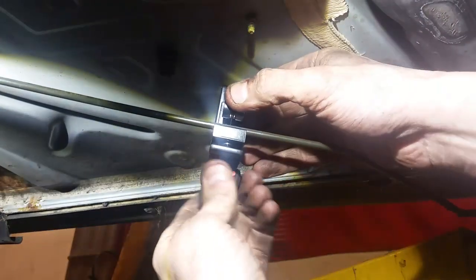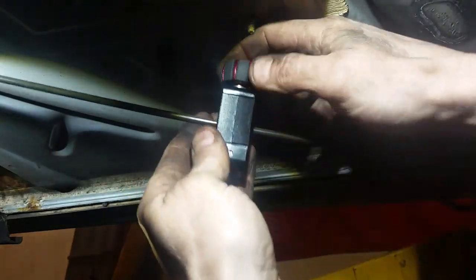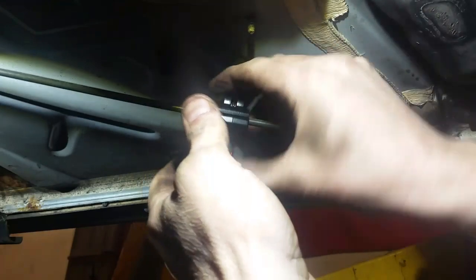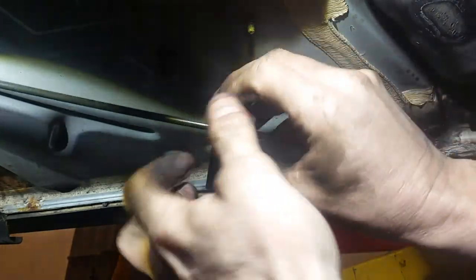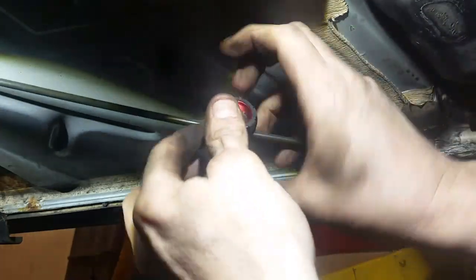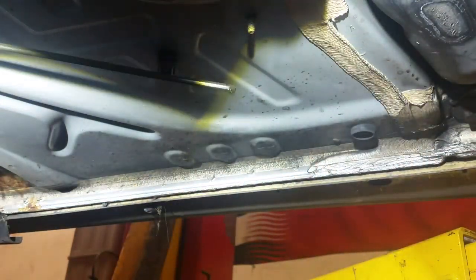So we're going to do a wee flare here. The whole trick about doing good, consistent flares is that you do good cuts, good preparation, no burrs, and you definitely don't even dream about cutting this with a hacksaw or anything like that. It needs to be a straight cut, it needs to be a clean cut. The only way to do it is use one of these wee roller boys. And there's a bit of fluid there.